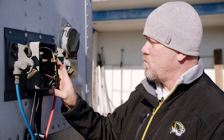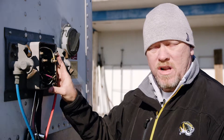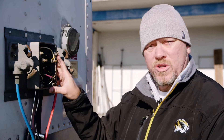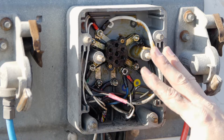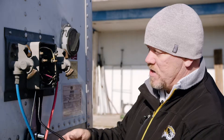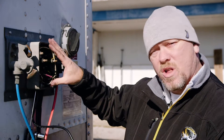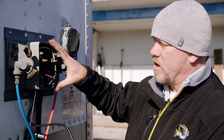Once we have access to the box, we're going to connect the wires and connect the device. I will caution you to check your manufacturer details on your individual trailer to make sure which wires you're hooking up to. What we are looking for on this particular trailer is the ABS wire or ABS system — that's the one wire that has constant power when it's hooked to the trailer. On this particular trailer, it happens to be the center pin, which happens to be a blue wire. You'll also have to locate the ground. We suggest running the wiring from the asset tracker through the bottom of the box, wire it inside the box so all of your connections are secure and waterproof.